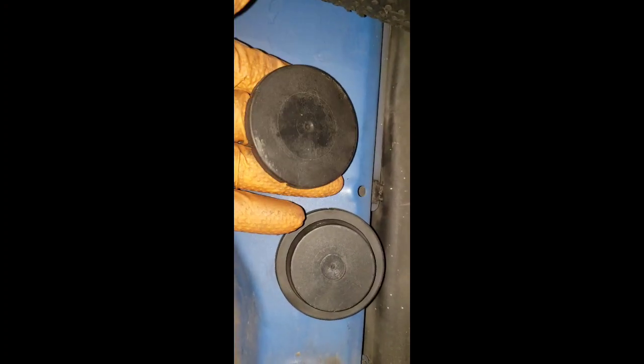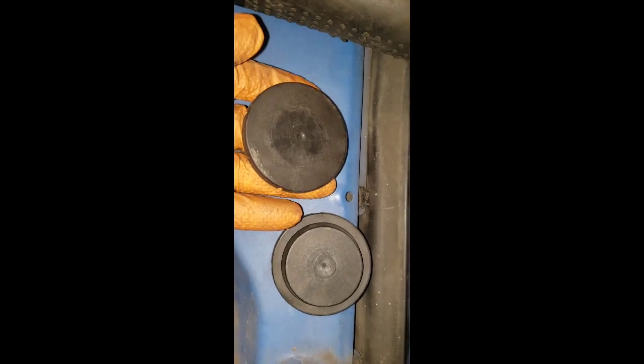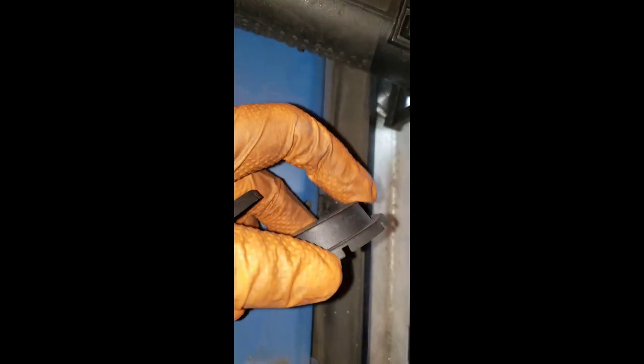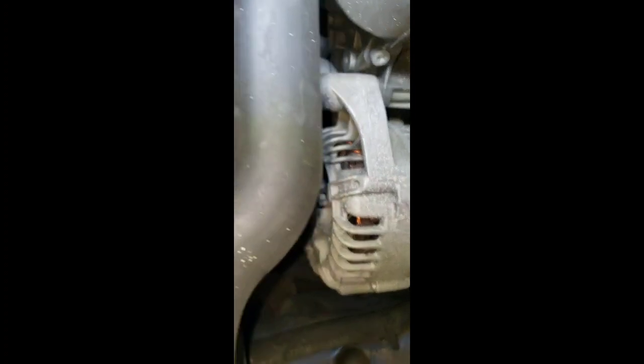This is the cover that has the bolt to put tension on to release the serpentine belt. This one is different - that one is more like a cap, but this flat one is the one I have to remove to put a T50 right there. My setup is already in place and as you can see, if I put tension right here it releases the belt.